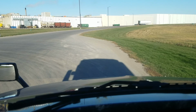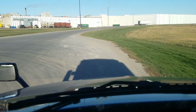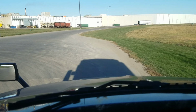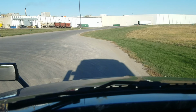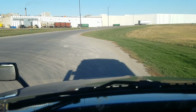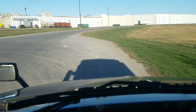Okay, so approximately 420 pounds of fuel if we go with a full tank. That'll put us at about 33,100 and 33,420 on our tandems. It's within 300 pounds of being balanced. That's pretty good. We're good to go. And that is how you scale your individual axles when you've got a gross scale weight, one axle at a time.